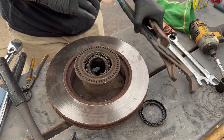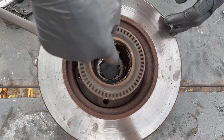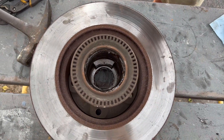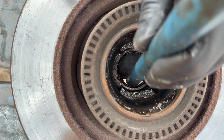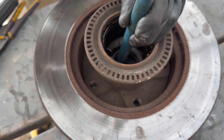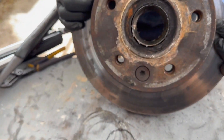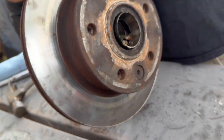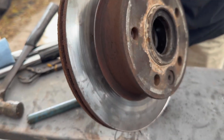This is just the seal and this is the bearing, and we've still got more to come out so the fun has only just begun. We'll get some of this noise-making stuff off the bench. We still have this bearing race in here and the little one in there that need to come out. I'm going to start with this face down, get a nice punch to sit on the edge in there, and tap that out. I'll go across from it — felt like it hit bottom there — push it all the way out. So that's one bearing race out.